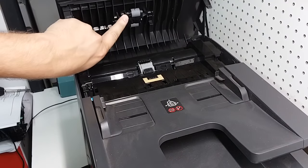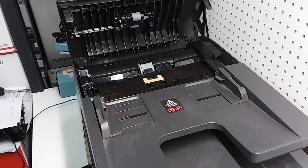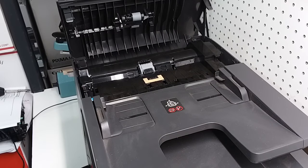Also, these rollers right here are going to accumulate a lot of dust over time because there's ink on paper fed through here and toner. It's going to be a quicker accumulation on these rollers than on the rollers that pick up the clean paper on the bottom.